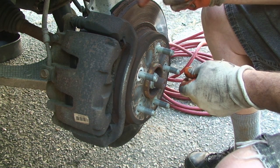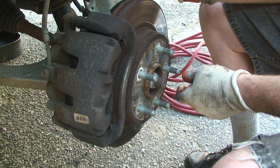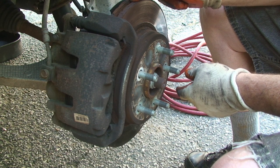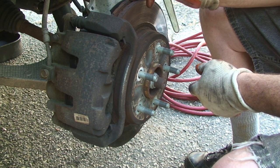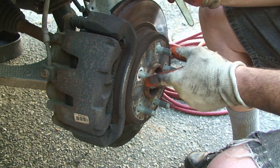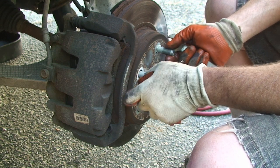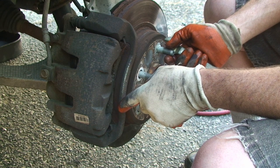So when I did the other side, I think I got it backwards. I know one of these was heating up. I thought it was the driver's side, but I actually think it's the passenger side that's doing it. So the other side went really smoothly. I have a feeling that since I'm recording this one, Murphy's Law dictates that this will be the one that's a pain. Because it does seem like there was some heat corrosion on the lugs. So, but we'll find out together.